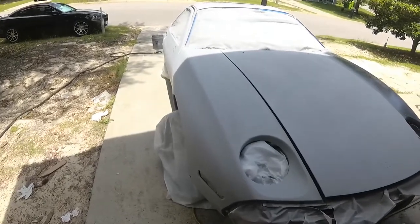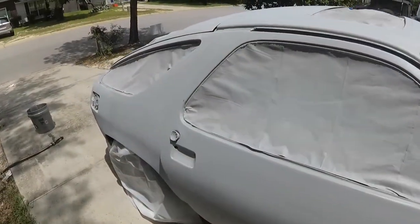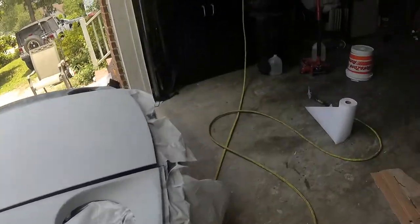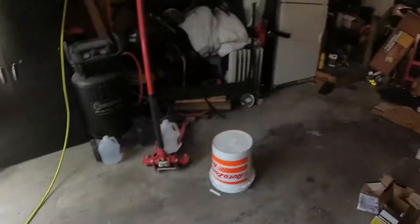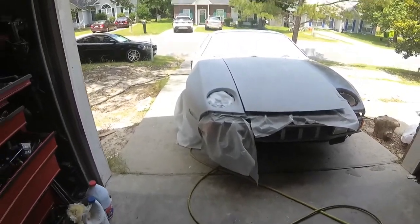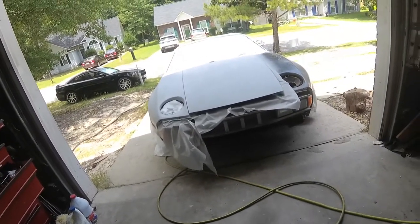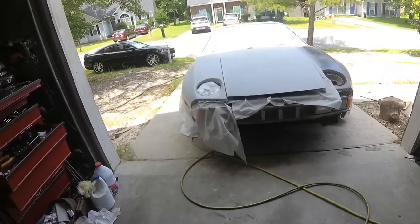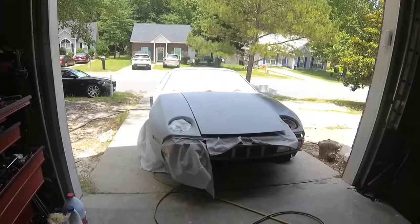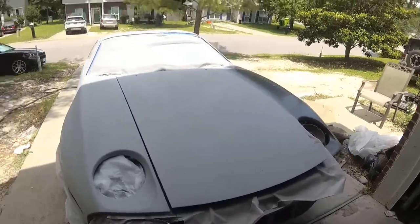It is tomorrow. The car is all blocked and surface cleaned, so we are going to start getting ready to spray sealer on it. All the rest of the parts are in the backyard — I already primed them, but they need a little more dry time and sanding, so I'll do them separate. Since it's a little on the warm side today, about 90, the time between coats is probably going to go down a little bit from the normal spec, so we'll just roll with it this way.